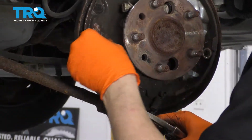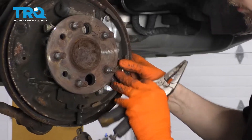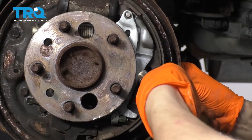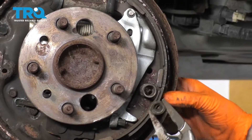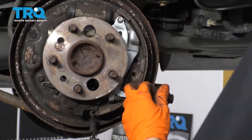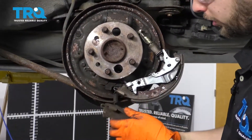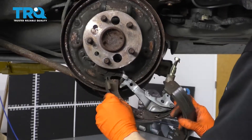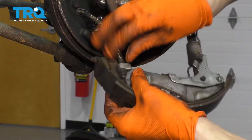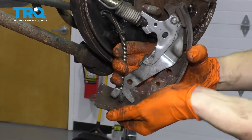Take that off. Now you can pull the shoe off and the pin can come out through the backside. Do the same thing on the other side — fortunately, this side is not as rusty. For this side, I'm going to use my locking pliers, clamp onto the little cap of the spring, press in, twist 90 degrees, and remove the spring as well as the pin. Hold the brake shoe so it doesn't fall and remove the whole assembly. You can disconnect the two shoes on the bottom with the little spring. Next, disconnect the parking brake cable from the brake shoe by gently prying the spring backwards and pulling it up.